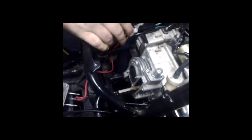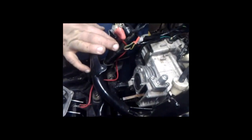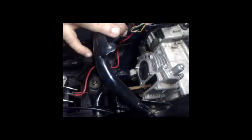When you put the piston into the cylinder wall, you want to lube it up a little bit, so when you're pushing it in there, you don't scratch the piston or the ring or the cylinder wall. The top ring will be loose. You want to squeeze the top ring close to the piston and slide it in gently without using too much force. If you use too much force, the rings are very delicate. They'll break with any hard pressure.